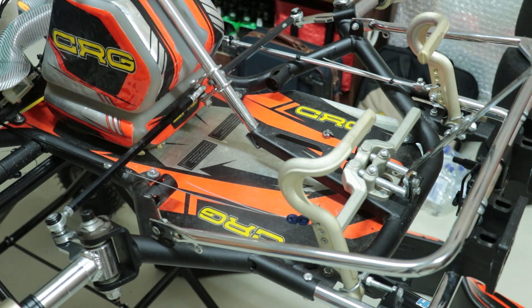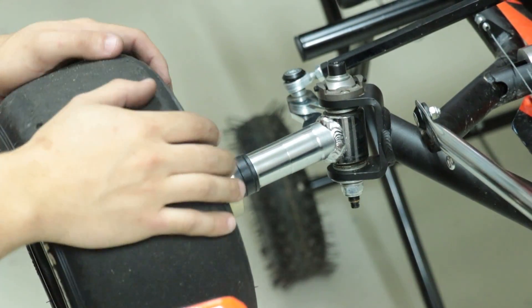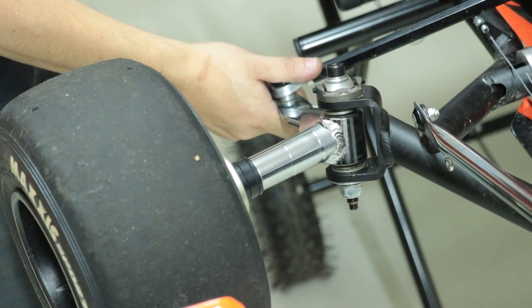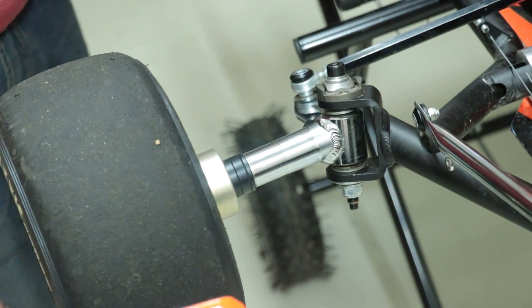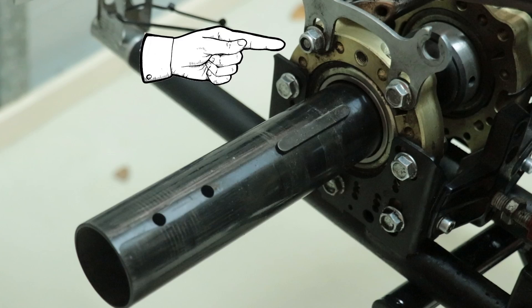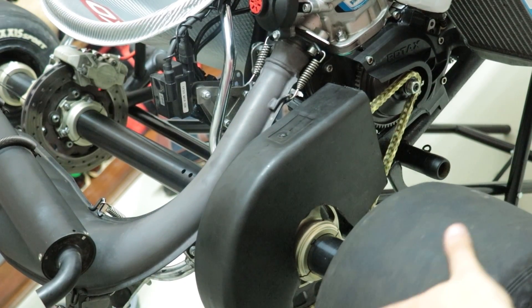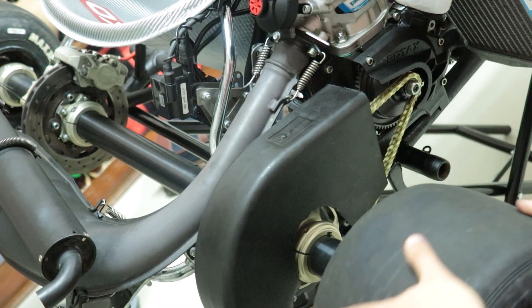Having a torsion bar should help the steering or at least give it a bit of extra grip. The thing about go-karts is they don't have any suspension, at least not in the same way a car does. A car has coil springs or leaf springs — a go-kart doesn't. The spindle and kingpin assembly that holds the front wheel on is pretty much welded directly to the frame. At the back there's no suspension either, and the axle bearings are bolted directly to the chassis. Furthermore, it's a solid rear axle — no differential — so no matter what happens, both wheels are going to spin at the same speed.